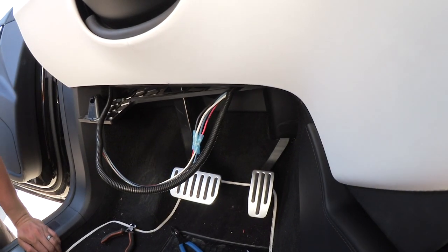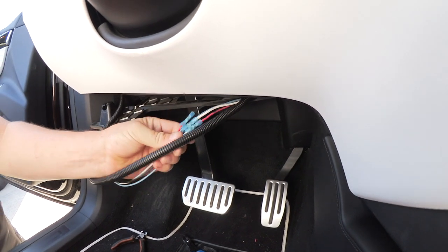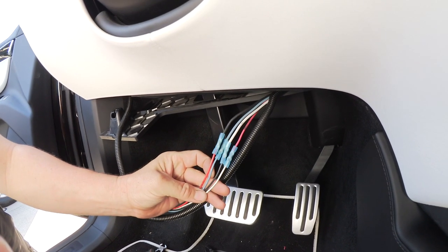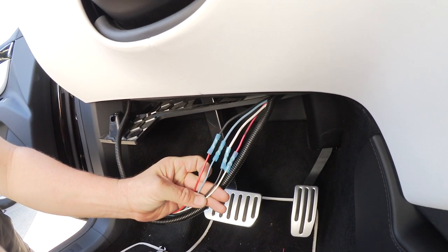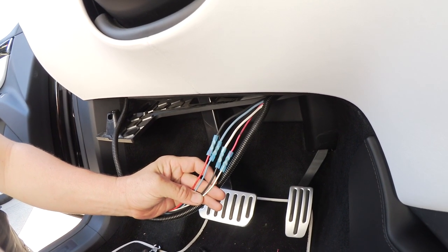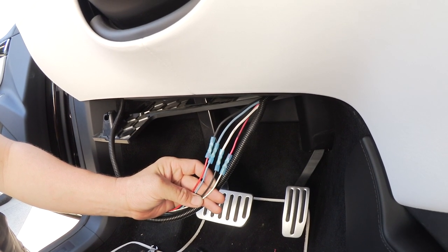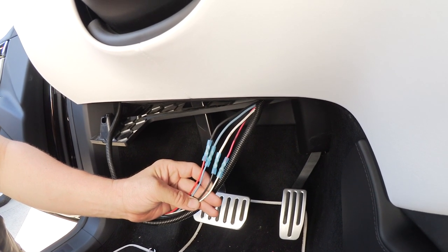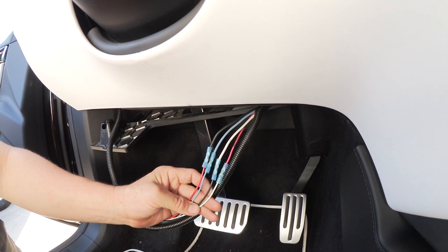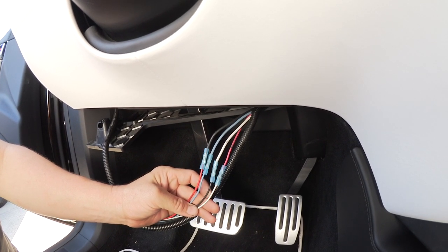The reason the brake controller did not work initially is that Tesla is not according to standard wiring colors. When you look at it: red goes to black, blue goes to blue, white goes to black, and white goes to red. These are the color standards from Tesla — and the brake controller had the standard industry colors. So we matched it to the standard colors originally, and that didn't work.